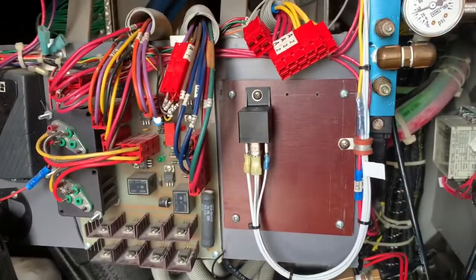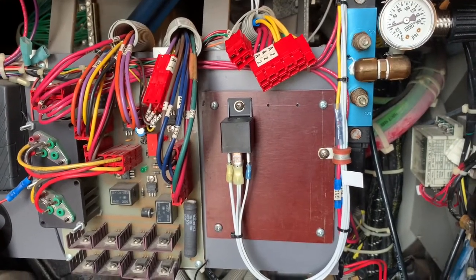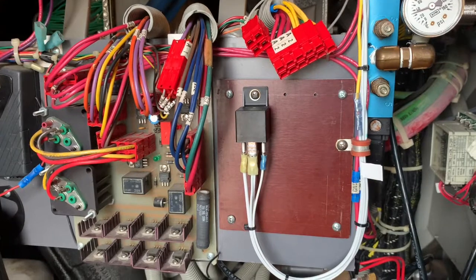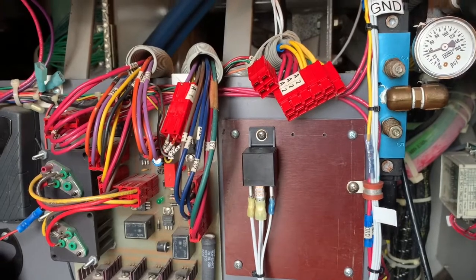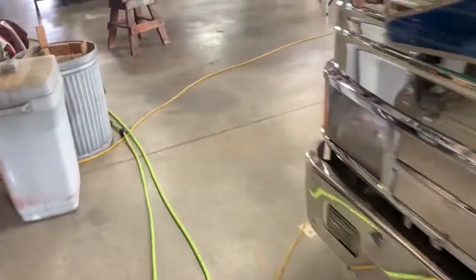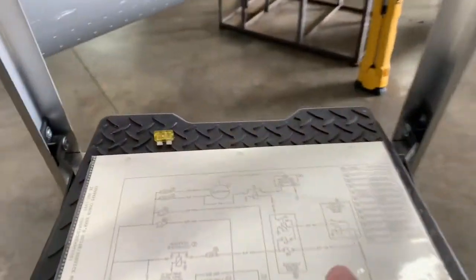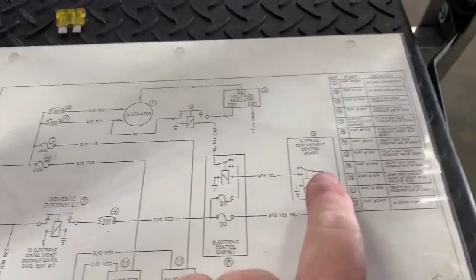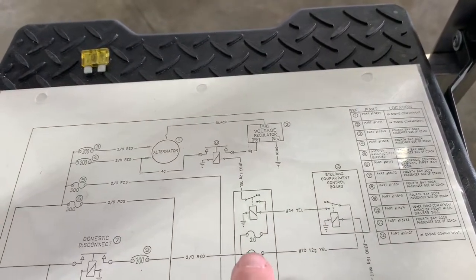Okay, we have made the board, mounted the first relay, which should control the house battery charging and the mirrors. There's actually 2 outputs that relay when you turn on the ignition switch. So I powered it on and immediately blew a fuse in the ECC. So it looks like this relay is now functioning. It's closing, but when I tried to power this relay, it blew that fuse.